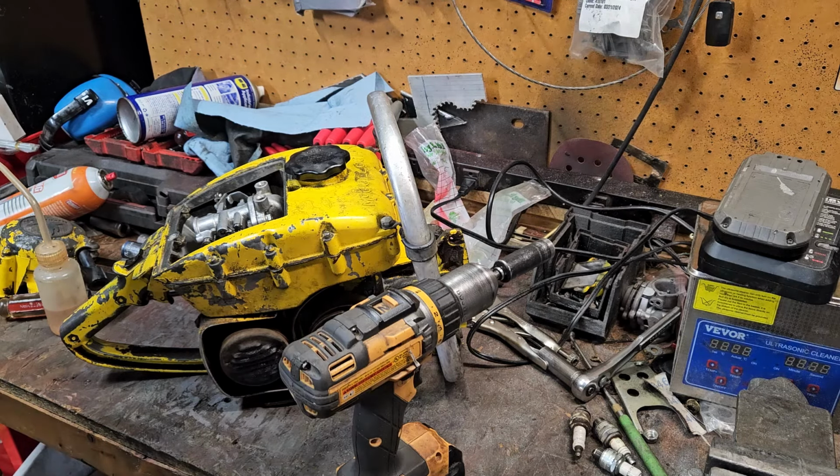It's definitely not a fuel issue. I don't know how much of the video I've edited up to this point explaining stuff, but it's definitely ignition related, because when it's running great, but then it just goes back to being temperamental. So there's something definitely up with it. I don't know if the condenser is bad, but it's kind of showing symptoms of either condenser and or coil. Because when I check spark, it starts out really bright and hardcore. Like, it's really good. And then the spark, as I'm rotating it, dwindles down to something smaller.